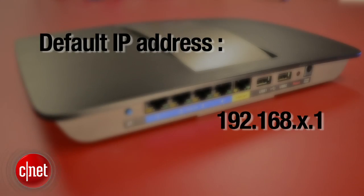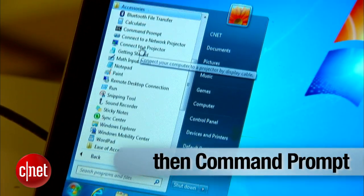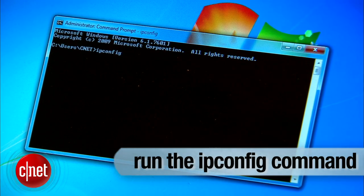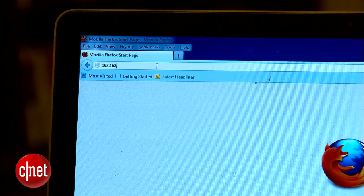It's quite easy to find out the router's default IP address, because almost all the time they come in this format: 192.168.x.1, with x being either 0, 1, 2, 3, 10, or 11. Or, on a computer connected to the router, you can find out by going to the command prompt and using the command 'ipconfig.' Here, the default gateway IP address is the IP we want. For this particular router, the default IP address is 192.168.10.1, so let's type that in the address bar of the web browser.